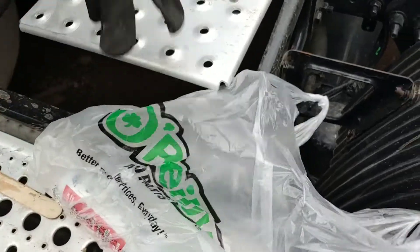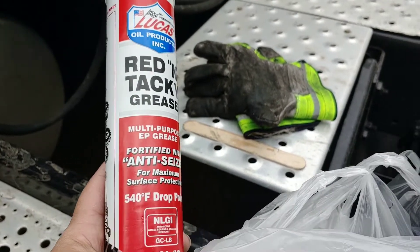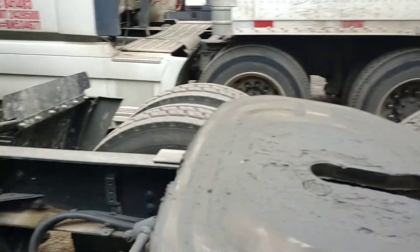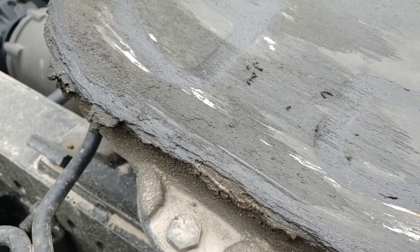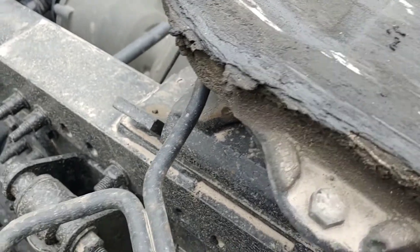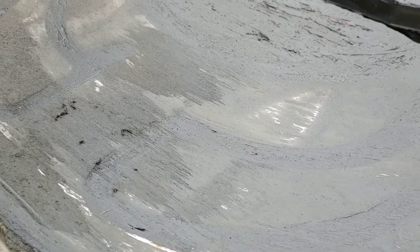The other thing I'm going to do while I'm here is put grease on my fifth wheel. I've got a pair of gloves specifically for this job. I got an applicator because I don't have one of those electric pump things yet. I got this red and tacky grease, which is what they put on fifth wheels anyway. It's been a couple of weeks since I was disconnected from the trailer. There are places on the trailer where the grease has gotten a little bit thin, even though I put quite a bit on it when I do it. You can see here it's kind of dry. There's plenty in the middle there, but to me it's just a little too dry, so I'm going to put the roller grease on.